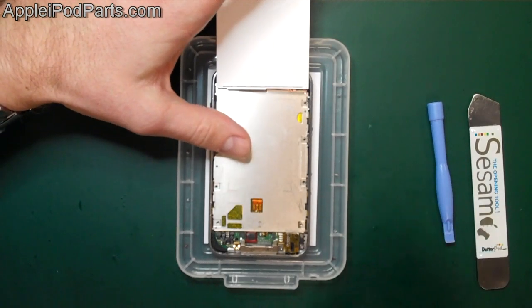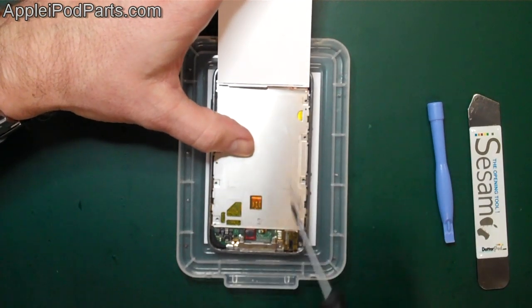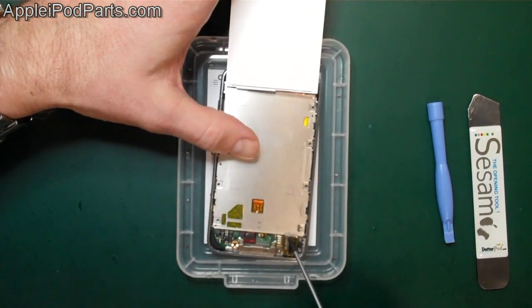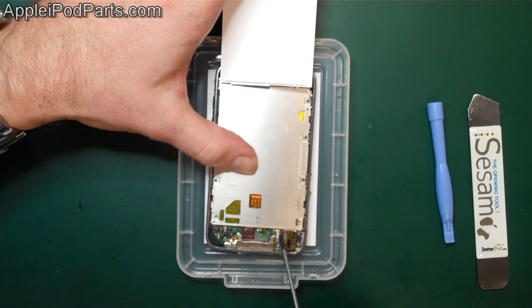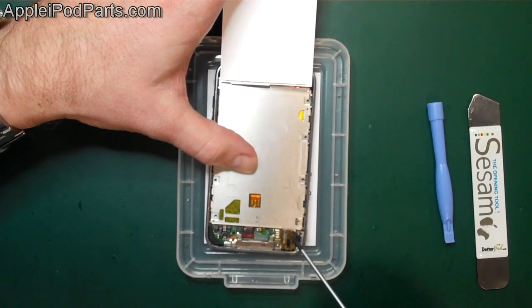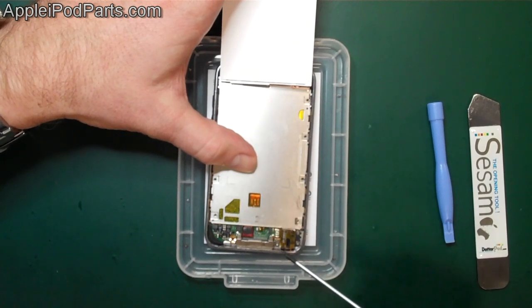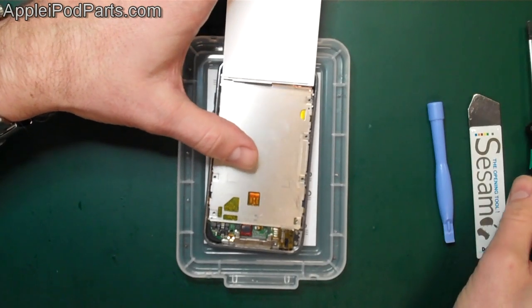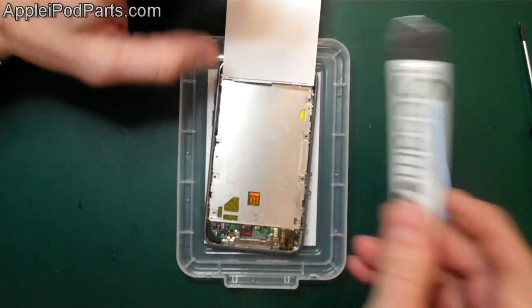Now, at this stage, when you've got the LCD up, the common fault with these is the headphone jacks. If you get up to the point where you need the headphone jack replacing, it's those 1, 2, 3, 4 solder pads and a fifth one there, and those two screws there, and it lifts it out. Now, you can do it without taking the plate out with loads of practice, but I suggest you go as far as taking the plate out. It's a lot easier.